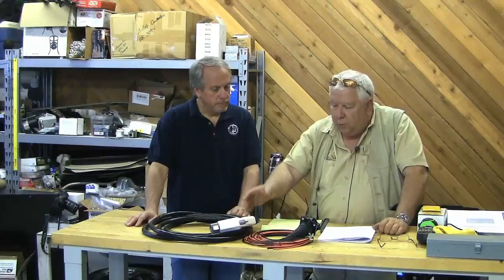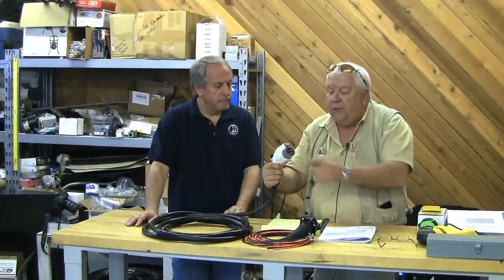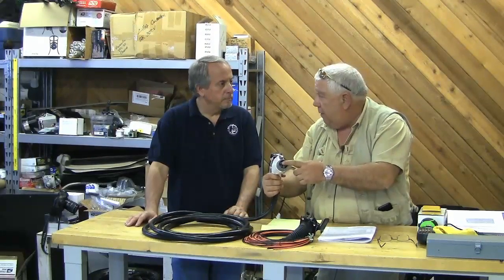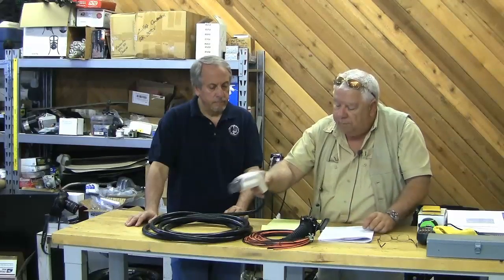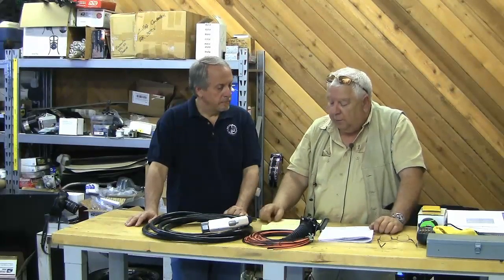When this isn't connected — when it's open — there is no power on the pins. You can drop it in a bucket of water and nothing grave is going to happen, other than perhaps a 12-volt signal. But there's no power on the pins at all, and there won't be until the charger talks to it a little bit by varying these impedances.